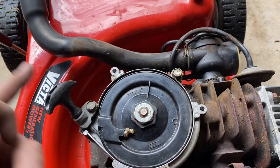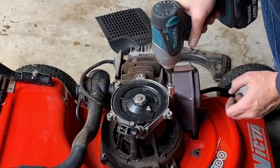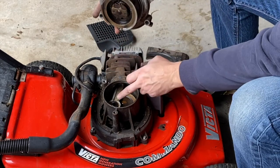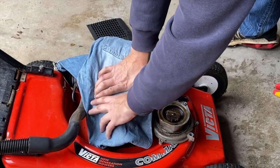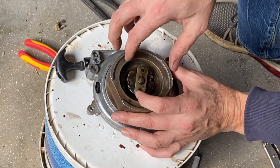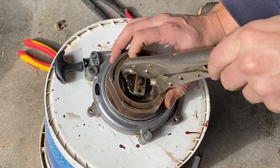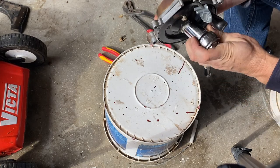Now that we've got the fuel tank off we can remove some of the extra plastic bits out of the way. The next thing we're going to do is use our 12 mm socket to undo these three bolts - that's going to take the whole starter mechanism off and expose the top end of the engine. In here you can see we have an o-ring - that's the crankcase o-ring, so be careful with that. I'll pop an old rag over the top of the engine to stop any debris falling in. Now the pull start spins out like that, and you want to use some vice grips to get on a diagonal and lock it so it does not come out. With that clamped, we use our 24 mm socket or spanner to loosen and undo that bolt.